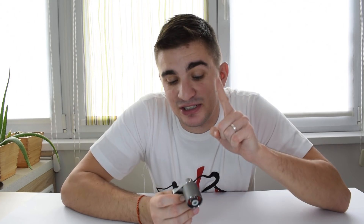It's right here that this little guy steps in and solves this whole conundrum. It's installed right on that unsupported side of the timing belt and it prevents it from flapping around when you release the throttle, and also prevents it from ever skipping a tooth. This means you can run your timing belt at its normal tension, which prolongs the life of your timing belt and your engine — which is always an awesome thing. It doesn't make any horsepower, but it makes your horsepower last longer, which is sometimes just as important.